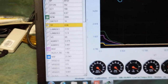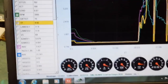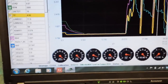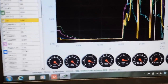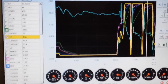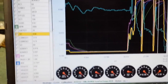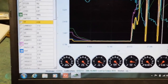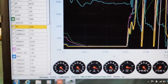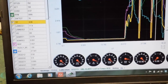It seems to be working pretty much like stock after I modified that mass airflow, so I'm not worried about it. No drivability issues, so it ain't broke, nothing to fix right now. So I'm pretty much ready just to make that adapter plate and probably just connect it right from the outlet of the turbo. See how that rubber stock hose likes that. I'm gonna have to make a couple changes to some of the connections on it, like the valve cover breather is not going to be able to be connected to that no more. I'll have to put an open air one or something on there. So anyway, stay tuned for some more of that.